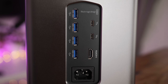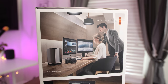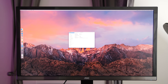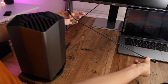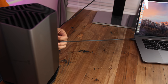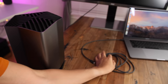Conspicuously missing from the Blackmagic eGPU is DisplayPort connectivity — not entirely surprising considering that a lot of the marketing materials show LG UltraFine 5K setups that use Thunderbolt 3. Thankfully, the included HDMI 2.0 port allows you to connect to a 4K-enabled display at 60Hz. Blackmagic is far from the only company to provide an inadequately short 0.5-meter Thunderbolt 3 cable, but a 2-meter active Thunderbolt 3 cable costs just a little bit more and gives you a whole lot more placement flexibility.